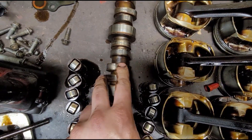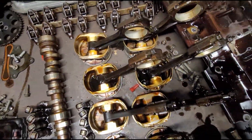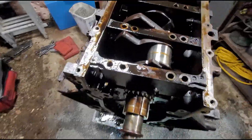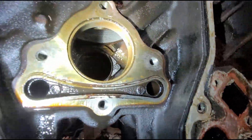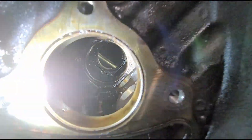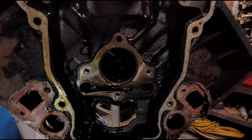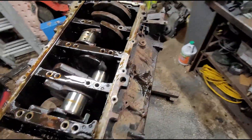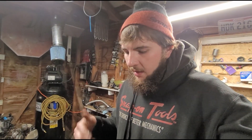The cam does have a little bit of pitting here and there, but nothing really to get too worried about. All of the connecting rod bearings look great. The one thing I did — that any LS guy will tell you not to do — is I looked at the cam bearings. They've got a little bit of wear to them. I don't know if I'm going to worry about those yet or not — it would probably be a good idea, but overall everything looks alright. This thing unfortunately has these super long bolts sticking out of the backside for the engine stand, so I have to pull the engine out and roll it over to look at the other side.